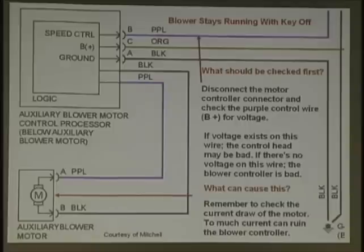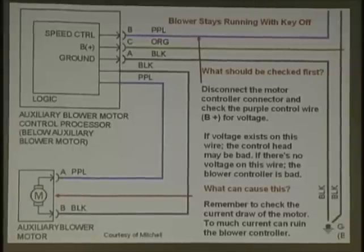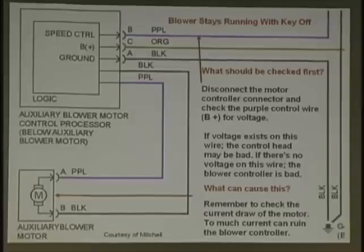Especially if you start using current ramping, which means checking the amperage draw. That reminds me, we had a vehicle come in with a complaint that at a stoplight or on bumpy roads, it was not having enough power. The shop put in a new fuel pump, new wires, a total tune-up, two computers. They went the whole nine yards and changed every sensor on the car. To make a long story short, anytime you stepped on the brake pedal, the current dropped. It should have been 6 amps, but it went down to maybe 3.9 amps. It wasn't delivering enough fuel. The reason with bumpy roads was that the brake light switch was not adjusted correctly.